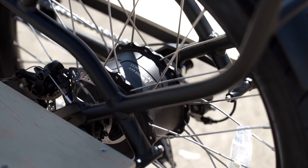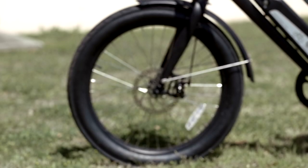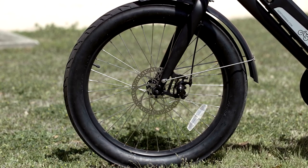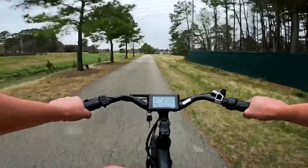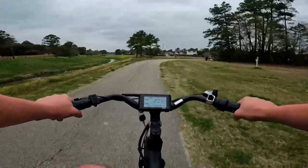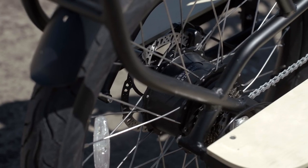As far as motor noise goes, it was very on par with other motors we get. These tires don't have those big knobs, so a lot of the road noise you'd normally get from fat tires wasn't there. They're a very fast-rolling tire and were a little bit quieter, so the motor may have seemed slightly louder only because it wasn't drowned out by big knobs. The bike comes configured as a class two, meaning its top speed is supposed to be 20 miles per hour, but we were pretty consistently getting it to 22. You've got this 48-volt battery and 750-watt motor — that combination should be able to get you to a higher top speed, and that's something that's very configurable in the advanced settings.